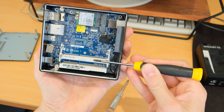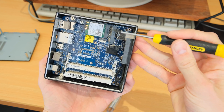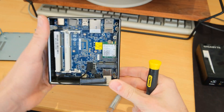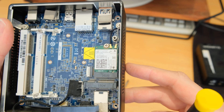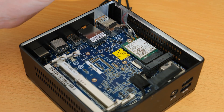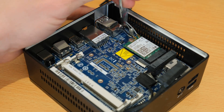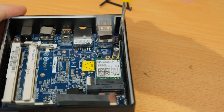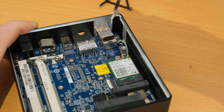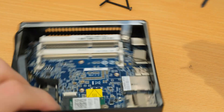I've already had this one stripped down. There's room for two DDR3 modules using the low-voltage variant, and we've got an mSATA port as well as Wi-Fi — it's actually a nice Intel chipset, an AC variant. To remove the motherboard from the chassis, there are two screws either side of the device and you can just pry out the motherboard to get to the heatsink and fan for cleaning.